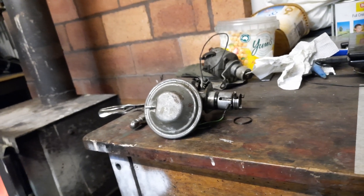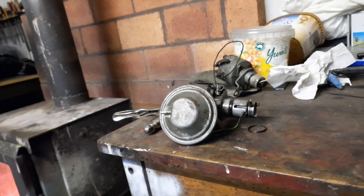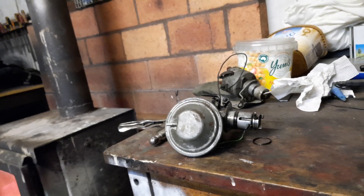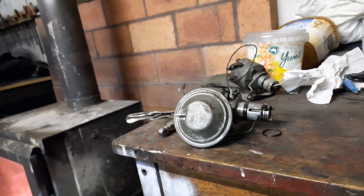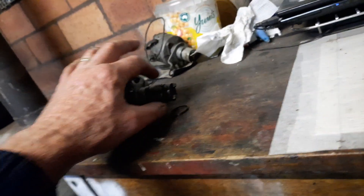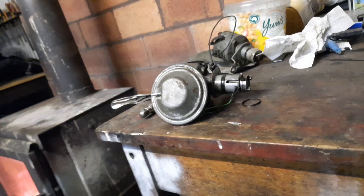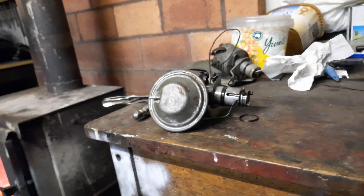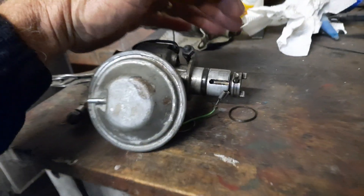It's worth thinking about — people go to a lot of trouble if the distributor drive shaft has been put in on the wrong stroke. This engine was like that when I got it, and yeah it wouldn't start. I swapped the plug leads around because the drive shaft was 180 degrees out, and away it went. Rather than pulling the drive shaft out, you could swap the distributor gear around, but that could confuse someone else down the track if they put a new distributor in and it won't go because it's 180 degrees out.